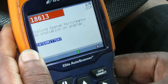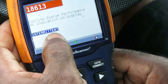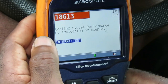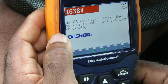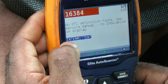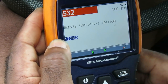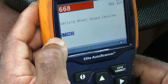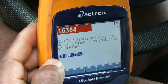Let's hit enter. We got a cooling system performance — no indication on display — that's an intermittent problem, not a hard code, but that will definitely cause that check engine light to come on. No DTC definition found. Supply battery voltage — we know we had a weak battery, that's a stored code but it's not going to trigger the check engine light. For the ABS sensor we had a varying wheel speed impulse. Our main concern right here is the intermittent cooling system performance.